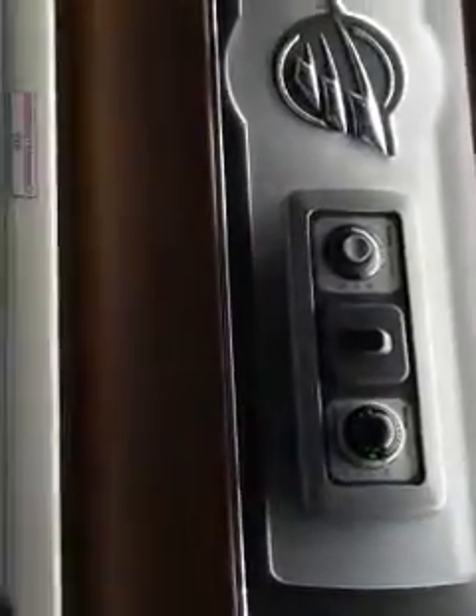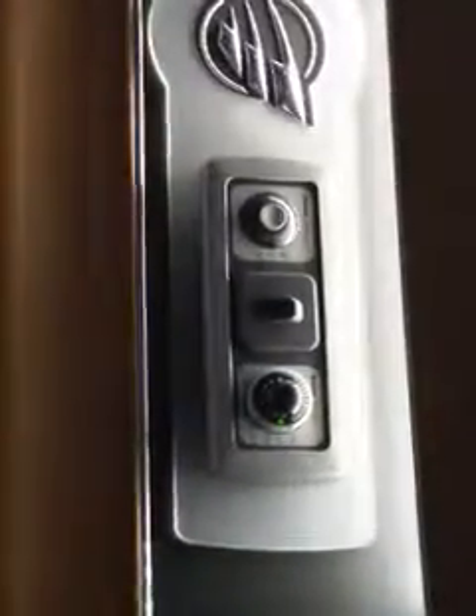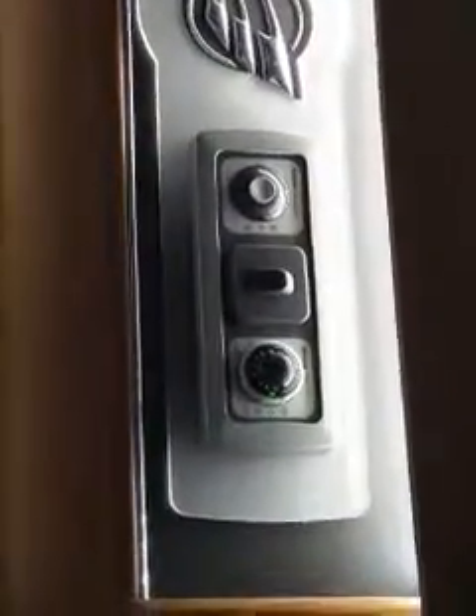The next one is your room heater. Again, you've got the isolating switch next to the water heater — the orange switch — which then comes back to this control here. You can see it says 230 volt, ultra heat — that's heating your room. Ultra store — that stores your water. So that's your water heater, that's your room heater.